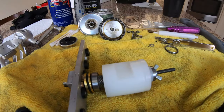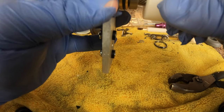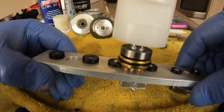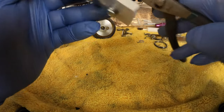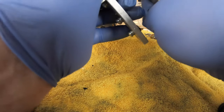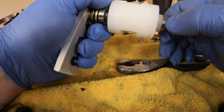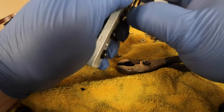This is that tool and this is how it fits on the pinion guide. This locks the whole assembly in place so it doesn't spin, so you're able to take that pinion gear off. It's a reverse thread, so I might need a bigger set of pliers. It's just gonna go clockwise - there we go, that's it. Just one quick little click.